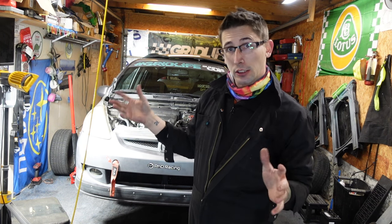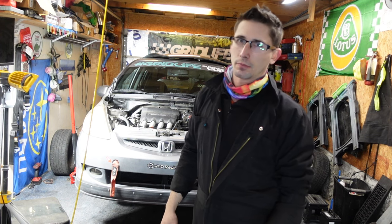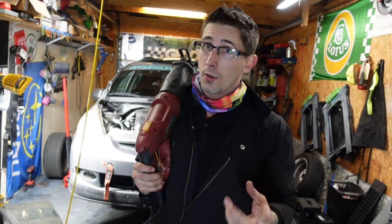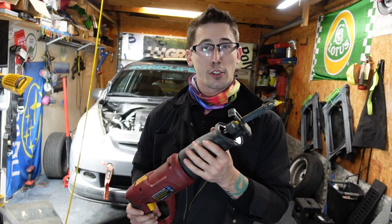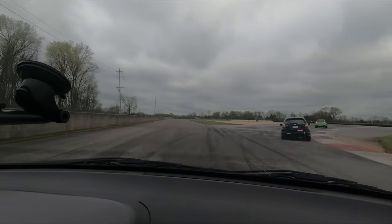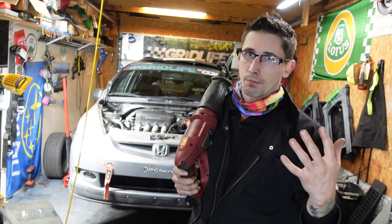The easy-ish way — not exactly the right way, but a little bit easier. It might involve one of these guys. To do it by the book, the correct way, you have to lower the lower subframe, which is a lot of work and not fun. So we're just going to chop it into two pieces and snake it out, since I don't use my front sway bar. A lot of the guys who track these cars don't run one — they have them disconnected. Mine have been disconnected, but I want to go ahead and remove it completely. That's extra weight I don't need.